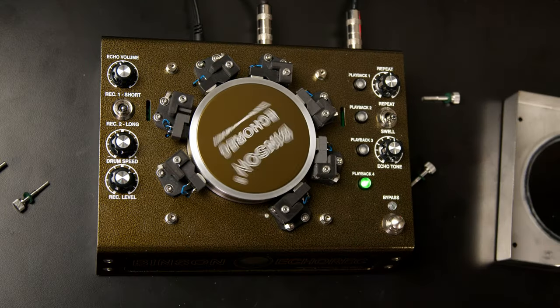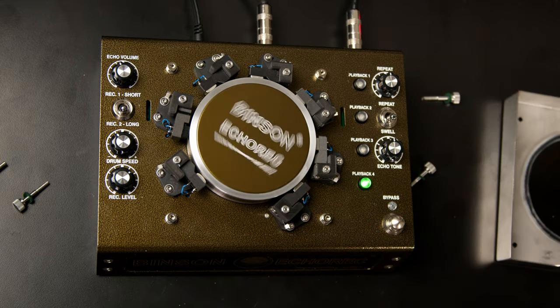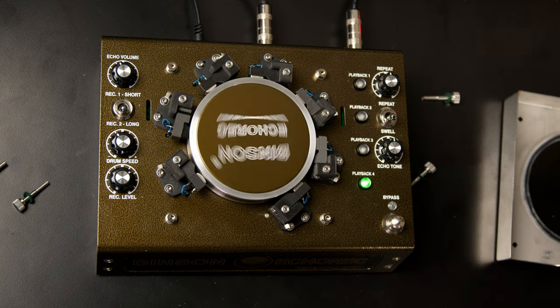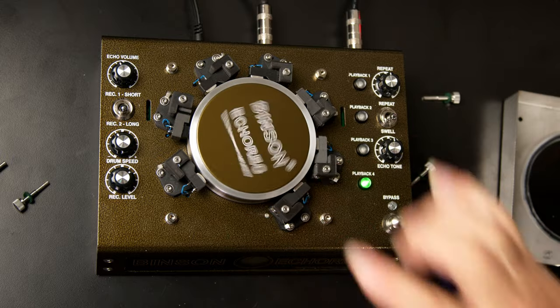I have to make a confession: in my normal approach I basically just unpacked the EchoRec, plugged it in, and turned it on, and what I heard was a clicking noise and a lot of background hiss. I thought I had a defective unit, but when I actually looked at the manual and the online quick-start video, I realized I hadn't set it up properly. It is a mechanical unit, so you need to make sure all the heads are in proper position, but more importantly you need to clean and lubricate the drum. It comes with cleaning pads and a bottle of oil — just a thin coating of oil around the outside smooths everything out. The click was gone, the background noise was gone, and it worked perfectly. Be sure to clean and oil it when you unpack your EchoRec.